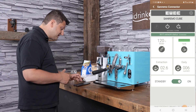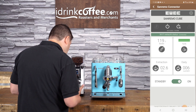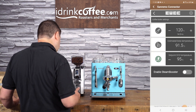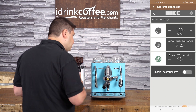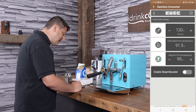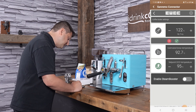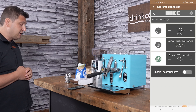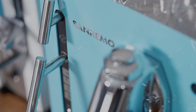There's a shot counter showing how many shots you've done today, and you can also see the machine's history. One of the main things you'll want to do is change the temperature — press the boiler and go into the boiler screen. Since this is a heat exchanger, you're controlling the boiler temperature, not the extraction temperature directly. Currently set at 120°C, the app shows an estimated brew temperature of 91.5°C. If I go up to 121°C, the estimated brew temperature becomes 92.7°C — a cool feature I haven't seen on heat exchanger machines before.